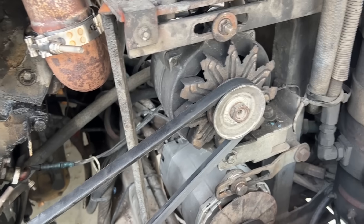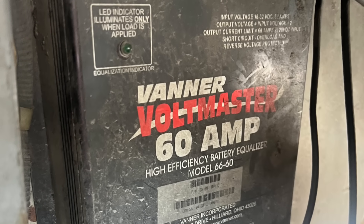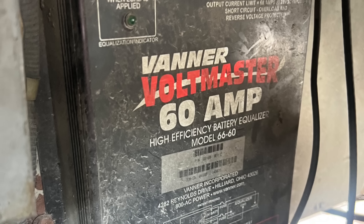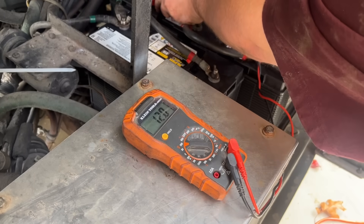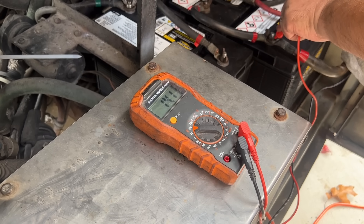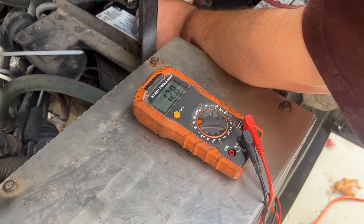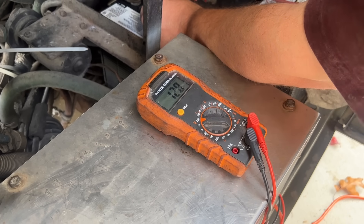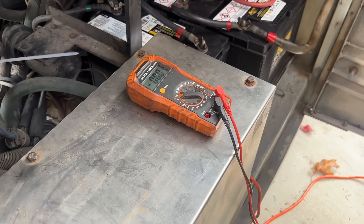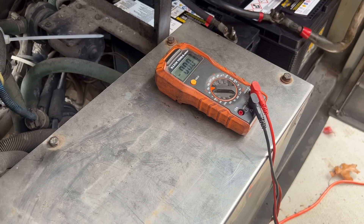As we got into it, it ended up being the Vanner equalizer. The 24-volt charger charges the batteries, and the alternator also charges the batteries at 24 volts, but the computer and some other stuff on the bus run off 12 volts, which is tapped in between — halfway between the full bank of the 24 volt. One battery was getting like 14.1, 14.2 volts — obviously charging — and the other was only getting like 12.8, which was basically what it was sitting at before we even started the bus. So half the batteries weren't getting charged correctly because the Vanner equalizer wasn't keeping them balanced — it was letting one set of batteries get more charge than the other across the 24 volt.